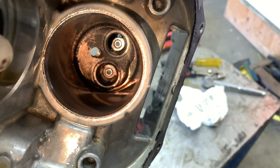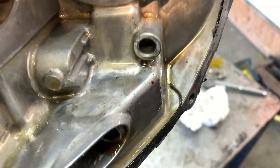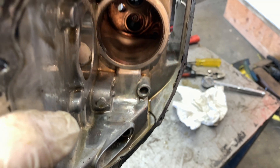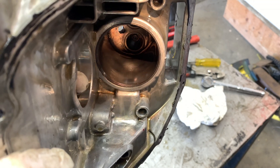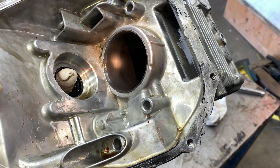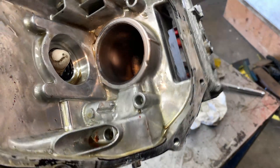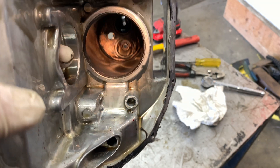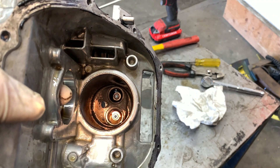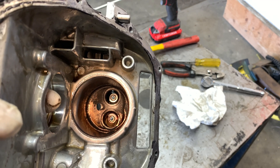That's causing the white smoke. Looking at the cylinder, it looks pretty good — I can still see the crosshatch in it. That crosshatch is still there; I think the cylinder is okay. I can definitely tell it's been run and there are some vertical marks on it, but they're not deep — they're just superficial. So I'm almost thinking that if I could clean the top of the cylinder, get all the carbon out of there, get all the gunk off of it, and lap the valves...